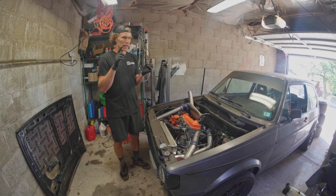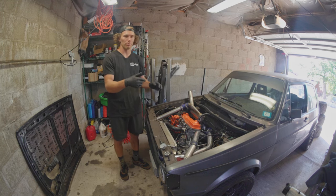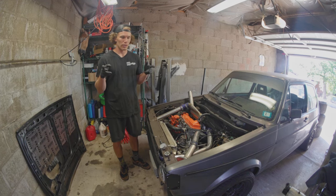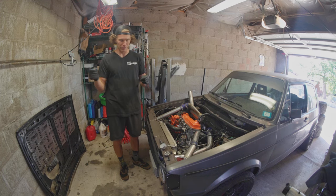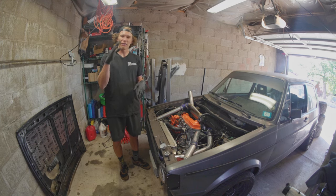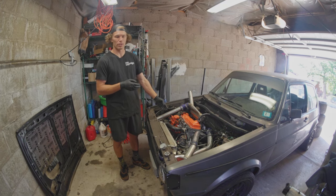Previously I tried 0.0385 inches of timing. On these pumps you're timing how far away the plunger is from injecting the fuel. That was way too advanced for this setup — especially with the high-lift cam plate, the different pump head, and the weak injectors. It injected the fuel way too soon, had no bottom-end throttle response, and felt only okay at the top end. I bumped it way down to 0.030 inches, and it feels really good on the bottom end, meaning low RPMs feel great. But I've noticed on my last few test drives with the Arduino that the top end kind of feels like we're not going anywhere. I want to see if that's injection pump timing, and it almost certainly is, since that's pretty much the sole thing that determines how this engine runs.